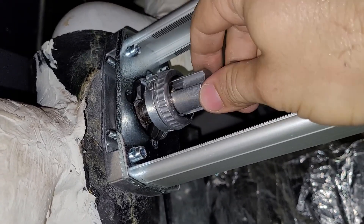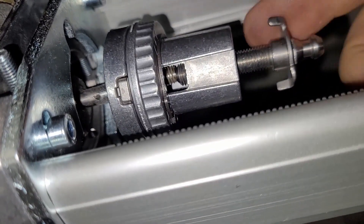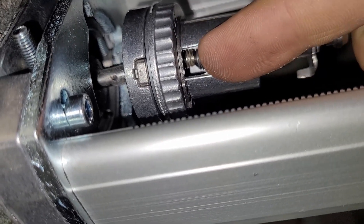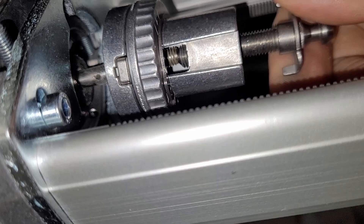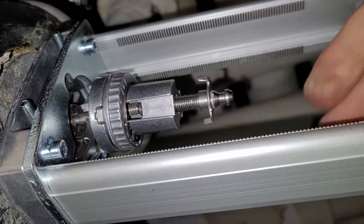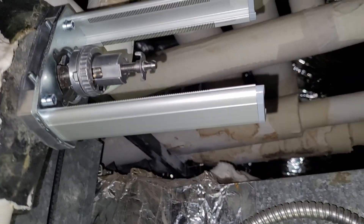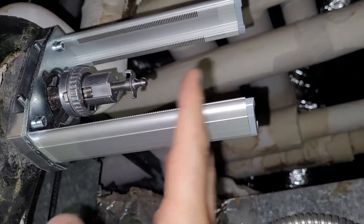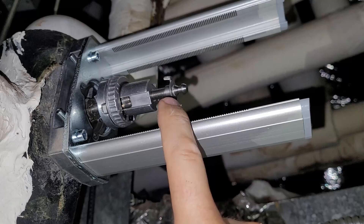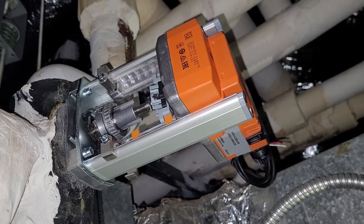You can see how this threaded shaft runs into the other threaded shaft and they bind real tight, so now it's just solid — that's how it was designed, pretty slick. Then I'm just going to slide the actuator down onto this tower and lock it in place and connect it to the stem.